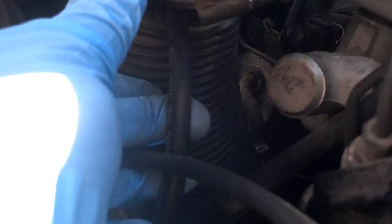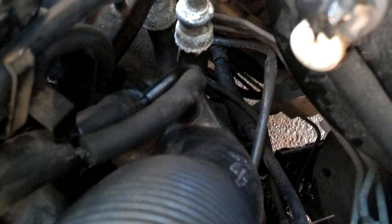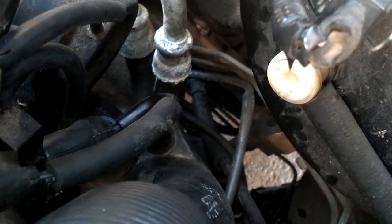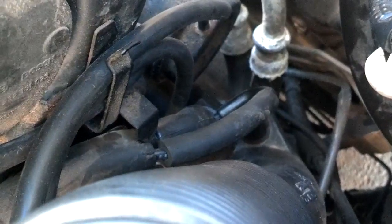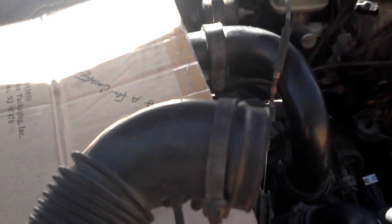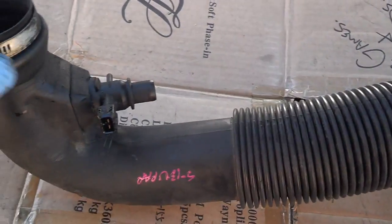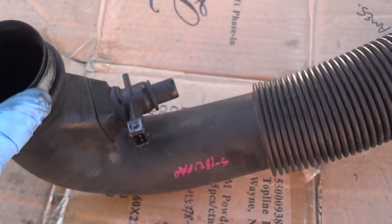I found it necessary to take the turbo intake hose out. Take the vacuum line off the bottom of that if you have one connected to it, then get a 7mm down on the base of it on the backside. Unscrew it, then take the two PCV lines loose from it. Unplug the PTC valve and take the ports off of it. Here's your turbo intake tube removed — you have the clamp up top at the MAF, the air line here, vacuum line there, your PTC valve plug, and your PCV lines.